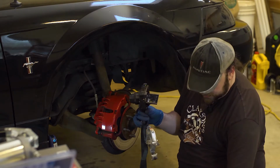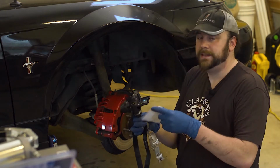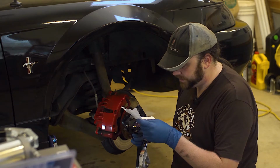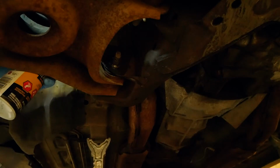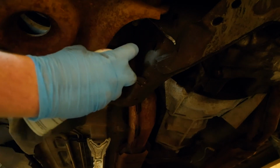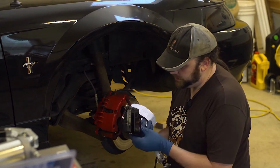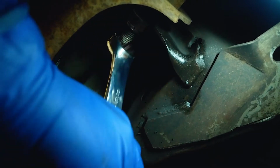What is my next step? I wrote this down. Leave the nut on there. Loosen the control arm nut. Oh, the ones in there. So, inboard, we have 2 nuts on the control arms that I've already put some penetrating oil on. So hopefully, should be ready to come loose.